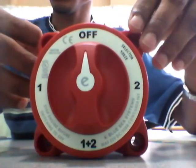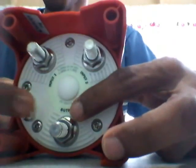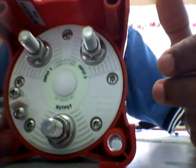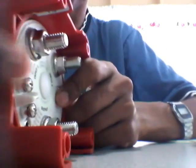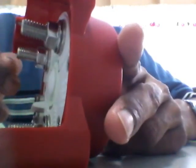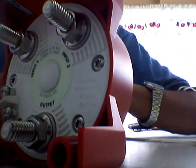I will now take a look at the connections at the back of the switch. At the back you have three main terminals: two input terminals and one output terminal. The input terminals are about two inches away from the output terminal, and the two input terminals are about 1.5 inches apart, so it gives you a lot of room. The opening where the cables pass through is open on three sides and is about two inches wide. The studs are tin-plated copper studs, constructed for maximum connectivity as well as corrosion resistance.